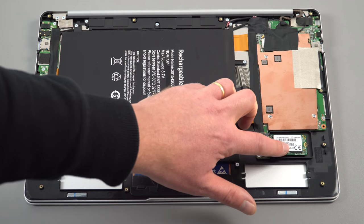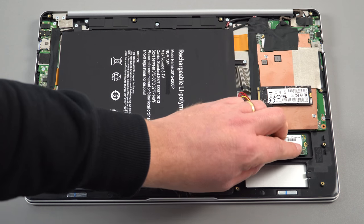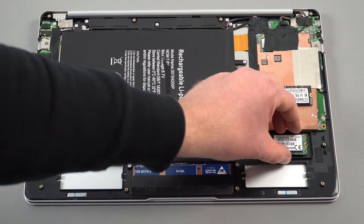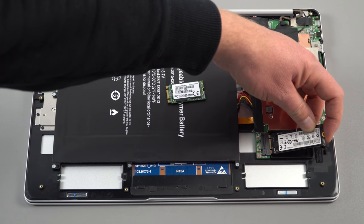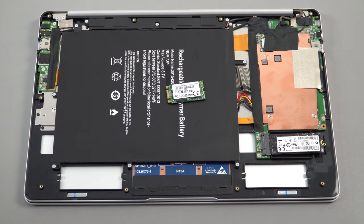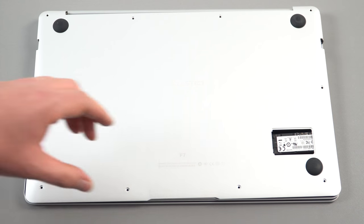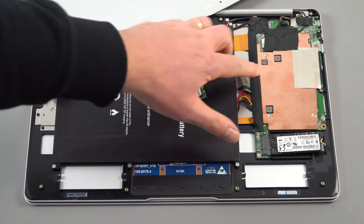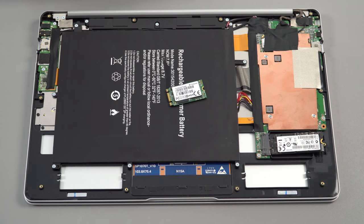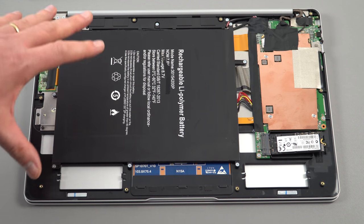Other laptops with the N3450 would hit 80–90 degrees without power limits. You can install a 2242 SSD here — there's room if you cut out a small plastic piece with a Dremel — though once installed you can't remove it without taking the whole lid off. Modders could also add a thermal pad here to transfer heat to the rear case, potentially dropping temps by another 5–10 degrees. The metal backing behind the keyboard is another positive — it's why the keyboard is so firm with no flex.